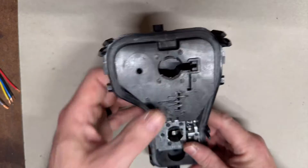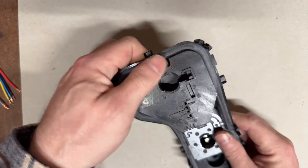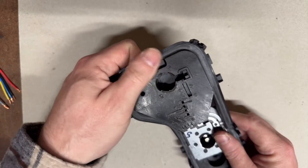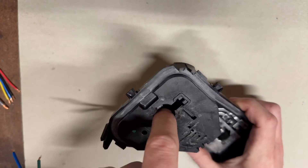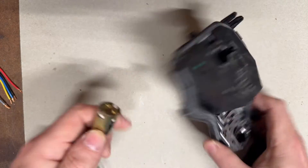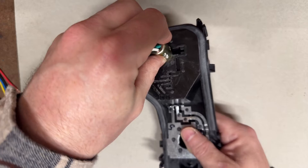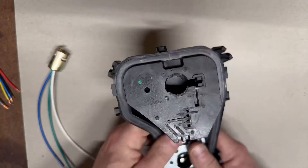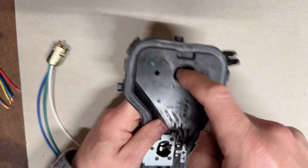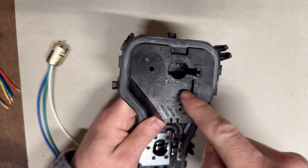That portion is completed. I went back in with a utility knife and shaved everything down, and also removed the lips that stick up. The next step is to get the socket into the housing — you'll need to drill a small wire hole in the bottom. The socket is just a little bit smaller, so all you have to do is run a drill bit through that's the same size. I need to go 11/16ths. You could also use a Dremel with a grinding disc. There's a 1/4-inch clearance hole for the wires — so we've got 1/4-inch, 1/8-inch, and 11/16ths.